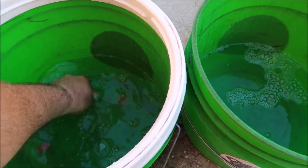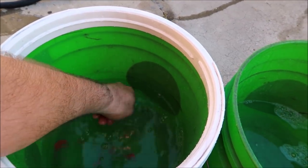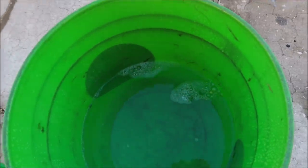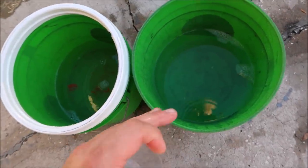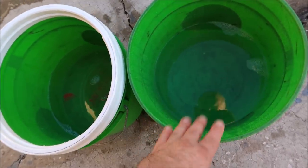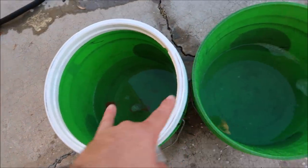I'm going to use the hose and shoot some water in here, getting it all out of the cup so we're apples to apples on dilution ratios. You can see the Perfect Soap sitting in the bottom of the bucket; you cannot see the Evo Shampoo — it absorbs pretty fast. The Perfect Soap is far more concentrated than Evo Shampoo. In this blend I wanted the acrylic to stand out, and we were able to do that without compromising cleaning ability at one ounce per gallon — it works fantastic.